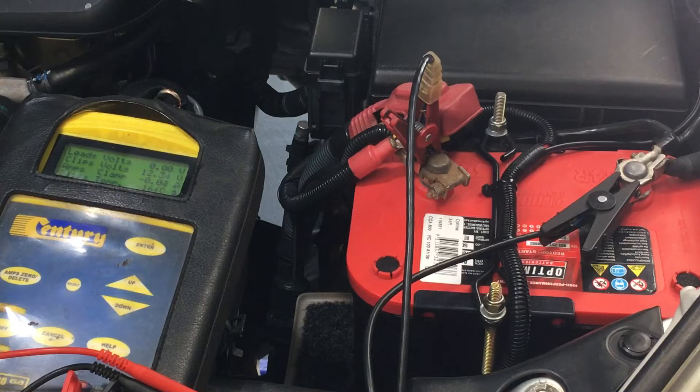The average life of a battery is about four years. If you've got a good battery and you want to rely on voltages, first thing you need to understand is if you charge a battery, it's going to have charge voltage during that and shortly afterwards. So if you've run the engine or had it plugged in on a charger, you need to let it settle for at least an hour - some batteries take even longer, 24 hours if possible, without any load on it.